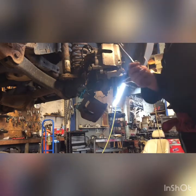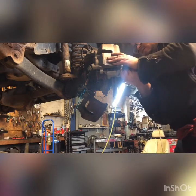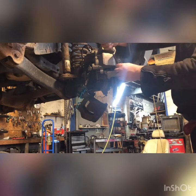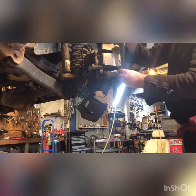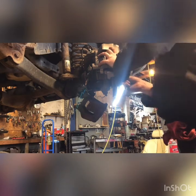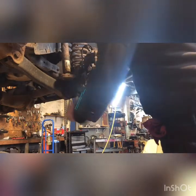And we got our little spring clip goes in here. It's pretty tough to get in. I put the top one in place and put it behind the mounting bracket. And then fit the next pin into the caliper part. Put a screwdriver in between the middle of that spring. Popped out. Seated in there all the way. Springs in. Beautiful. Everything's looking good. Now to transfer the caliper.